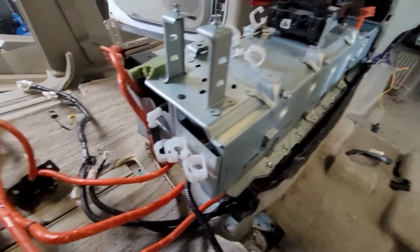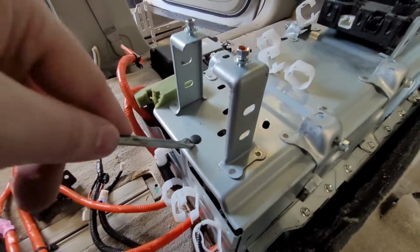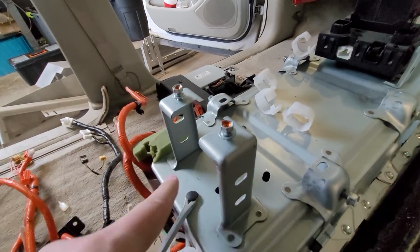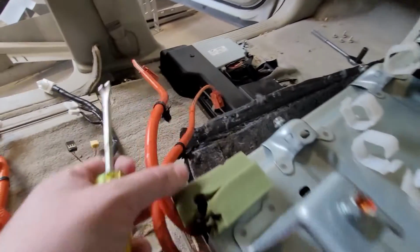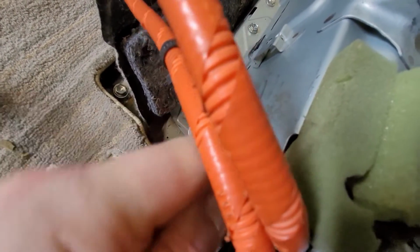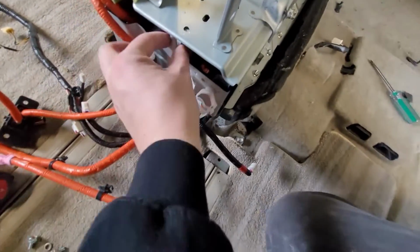It's kind of thoughtful. A lot of machines and companies, they're all just kind of like, let the mechanic figure out how to hold 3 things at once to line them all up. Toyota's like, nah, let's make them all the same size bolts everywhere. Same length, same thread, and let's give them these little pins. I mean, it's annoying because they probably break half the time, but that keeps it all lined up.